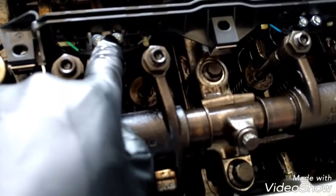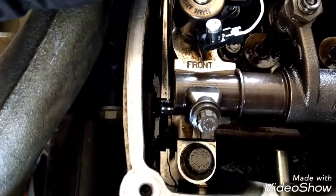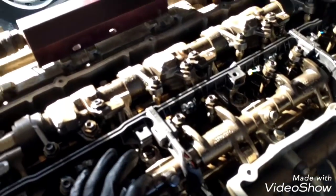Now we have to tighten all the bolts — there are nine harness bolts in total — and then tighten all the injector nuts. Don't forget about the J-brakes. The injector harness is in place, totally secure. The next step is to install the clips on the injector harness and then insert the plug to connect to the injector harness.